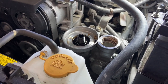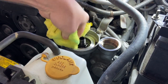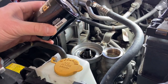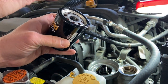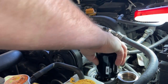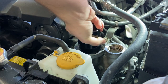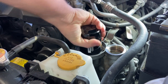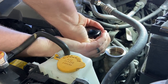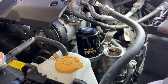This oil had about 5,000 miles on it before we decided to change it. You don't have to get it all off - just make sure you get most of it out. We have our new oil filter here. There is oil on the gasket - use nice fresh new oil, put a thin film, this will help seal it. Put your oil filter on. Hand tight - that's it, that's all you need to do. Two hands, hand tight. New filter is ready to go.